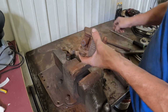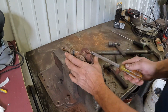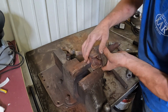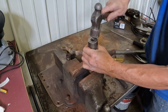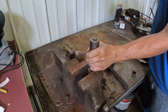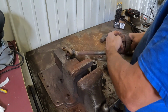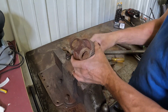Okay, and so this one was the one I was having trouble with the clip. I'm going to tap it in, which just made that clip really loose. And I can actually just get under it with a screwdriver and pop it right out of the way. And then we can flip it over and do the same thing on this side. Boom. Little pieces kind of fly all over, so it's fun to pick up, but just like that, we have our junk U-joint removed from the yokes.